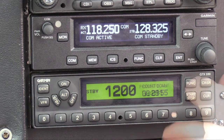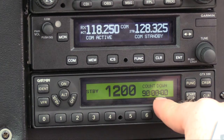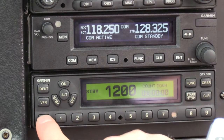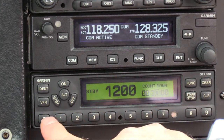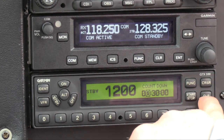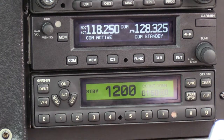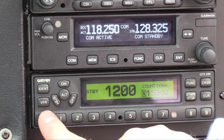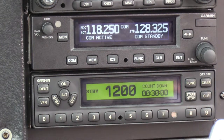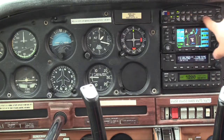If you're toggling through and you get to Count Down and it looks wrong — like 90 hours is not correct — you need to reset it. Hit CRSR and then punch in numbers: zero-zero for hours, three-zero for minutes, zero-zero for seconds. So if we want to make it one hour, or 30 minutes, or 50 minutes, we just dial that in. We're going to set this for the students here at the Aviation Explorers on this Cherokee to 30 minutes. To start the timer hit Start, and when you're doing a fuel change hit Stop, then Clear, and restart.